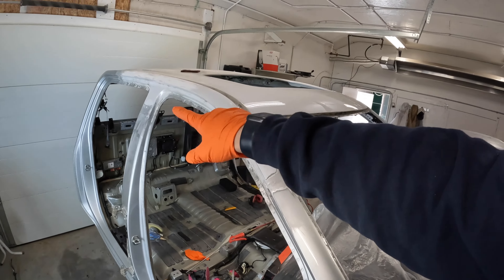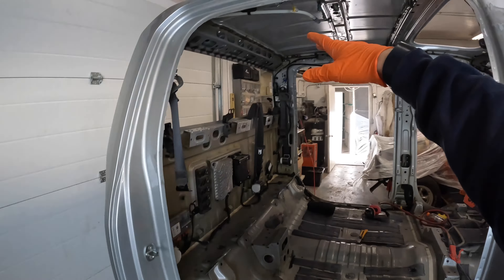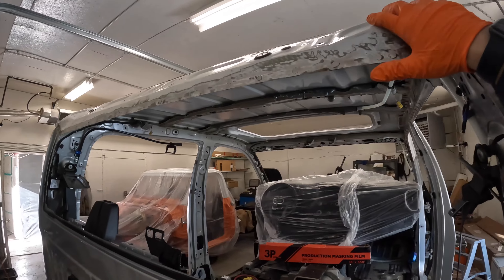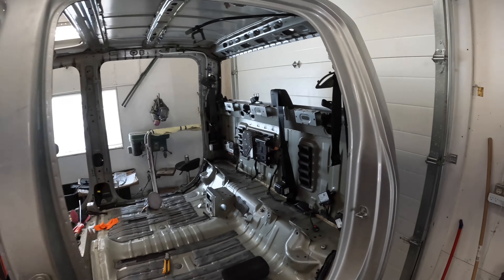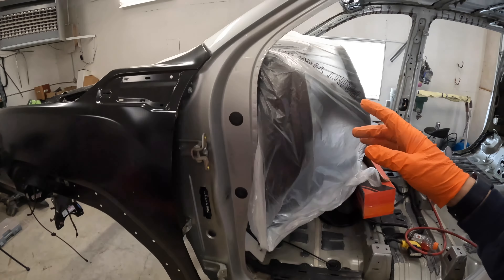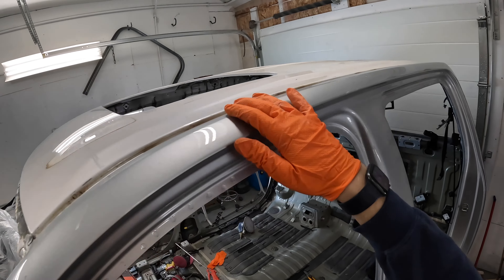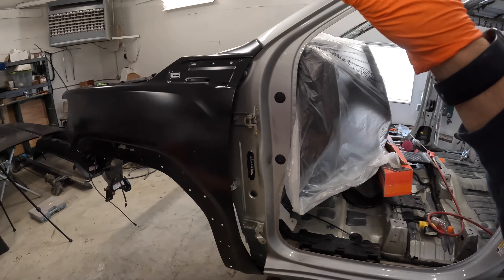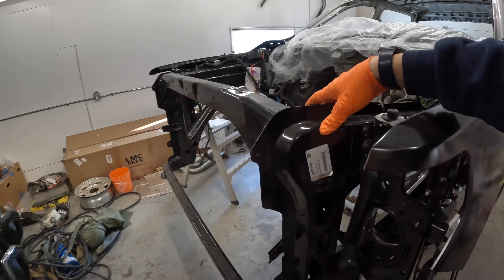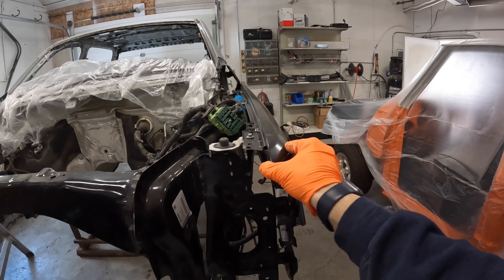Alright, so I got everything welded up and it's looking pretty good. I just need to do a little bit of body filler in these three little spots here and there's one little thing on the other side. Pretty much everything else I'm just going to clear coat and blend it — blend it to about here and then this area just gets covered so it'll just have seam sealer. The uni side is all good except for one little ding right here and one little ding on top somewhere. I'm going to clear coat the whole entire uni side and paint these fenders all in one piece. I'll stick on the hood to check alignment and align the fenders side to side.